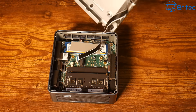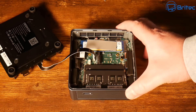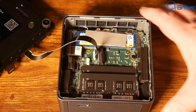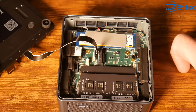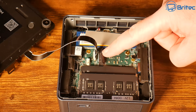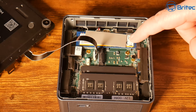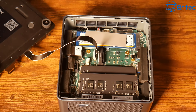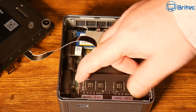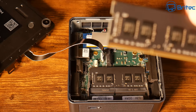This is a very powerful mini PC with an i9 processor — we'll go through the full specs shortly. Inside there's a Kingston 1TB drive; you can get a 2TB model. The secondary slot supports up to 1TB via a 2242 SATA SSD, while the main drive is M.2 2280 PCIe Gen 4 x4, which can also hold up to 2TB.